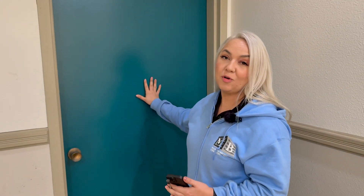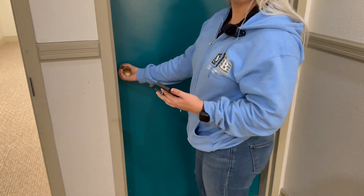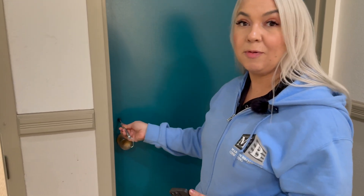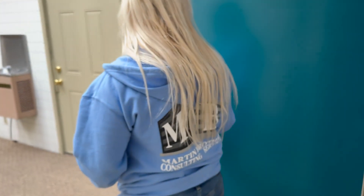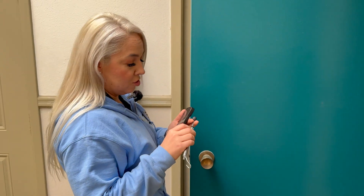So let's get started. We're going to measure this door. The first thing I'm going to do is measure the door opening pressure. I'm going to slightly crack the door to break the seal so that we can get an accurate measurement, and then I'm going to put this tool right here and apply firm but even pressure to open the door. Then I'm going to check my gauge — this says six pounds.